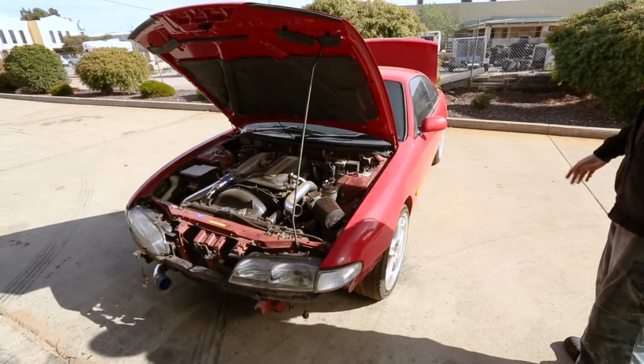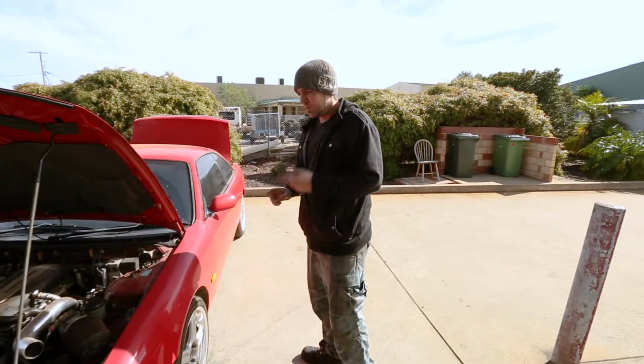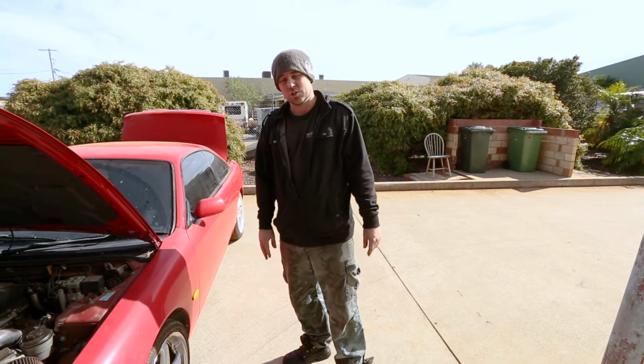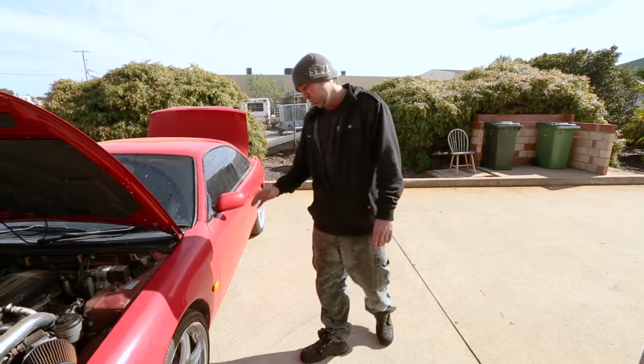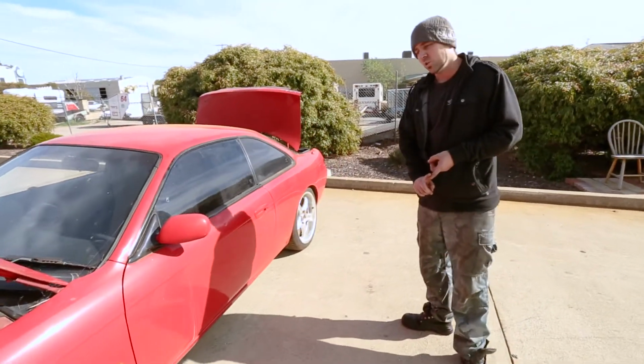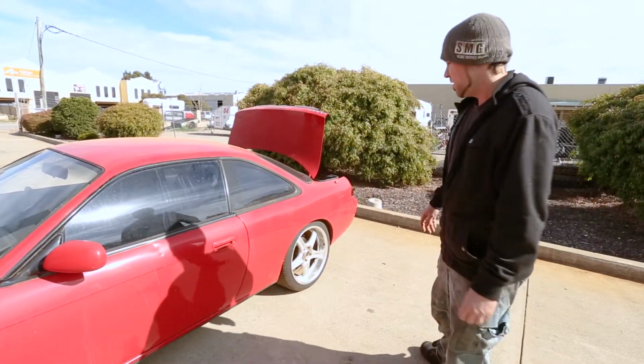We'll go through it and we'll put a flipped intercooler in it, shortened piping. We'll go turbo back exhaust, different ECU, Z32 airflow meter. We'll map it for about 250-ish at the wheels is what we're hoping. We'll put coilover suspension in it, new rack spacers with new tie rod ends and tie rods. We'll modify the subframe, caster rods, camber arms.